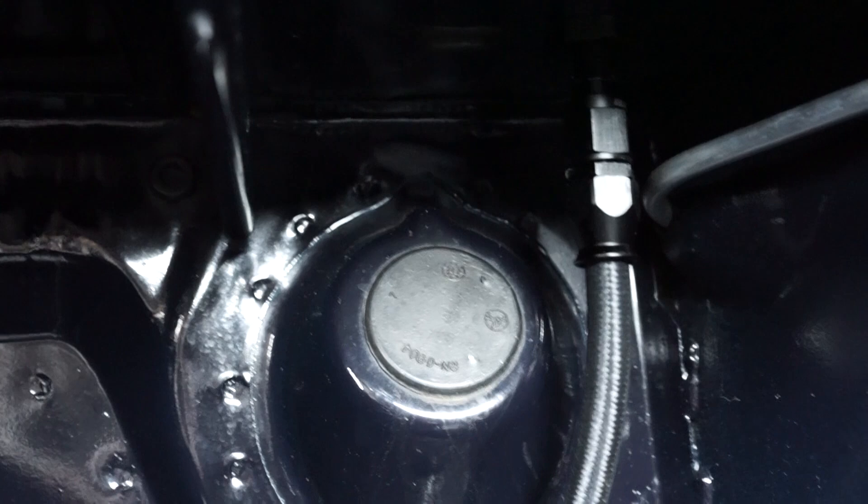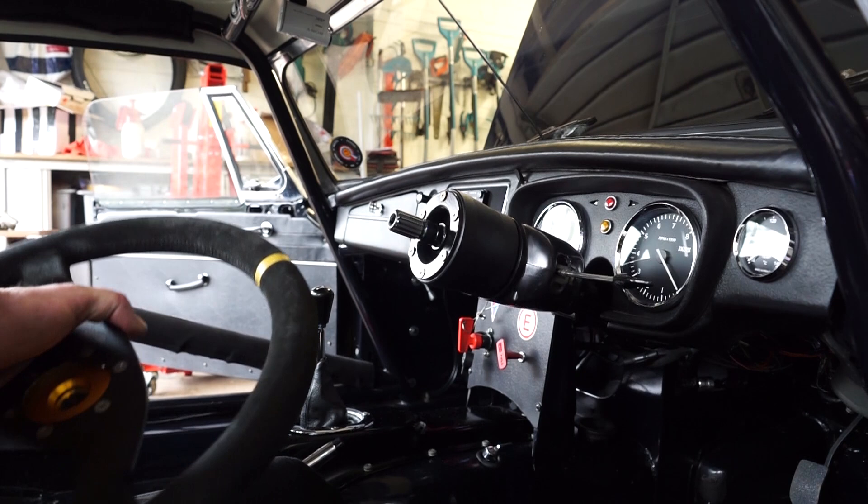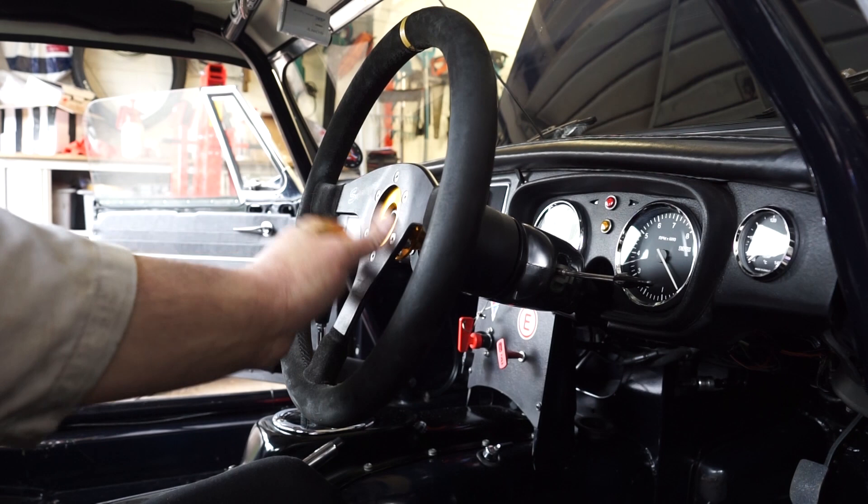In the interior of the car they will probably also look at your fuel lines. In my case they run through the vehicle - you'll see I've got a JIC fitting and the correct bulkhead fitting, with fire extinguisher lines there too. Just make sure that if you've got any holes in a bulkhead they're covered - there's a rubber cover on the steering hole there so everything is insulated as it should be. There's also a removable steering wheel - I notice that if you get out of your car at all they like you to put the steering wheel back in, just in case it needs to be moved.